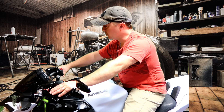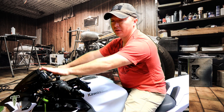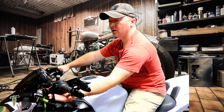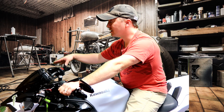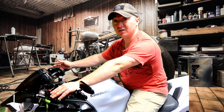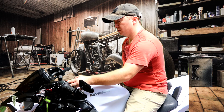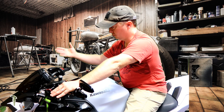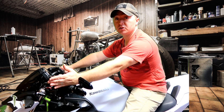I've already set my controls up. When I changed over to the short levers, I had to move the controls on the clutch side inward. There's an angle right here on the clutch that needs to match when you pull it in. With the throttle side, I also had to move it inward, so basically everything shifted to the left so these short levers lined up properly. Pitch angle is very important. You loosen these two screws here and rotate until it's comfortable. Start with whichever side you prefer — I went with the throttle side — then match your clutch at the same angle.